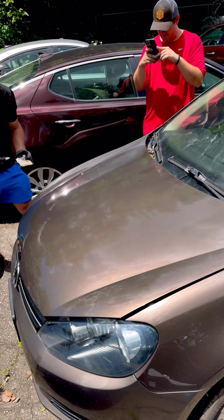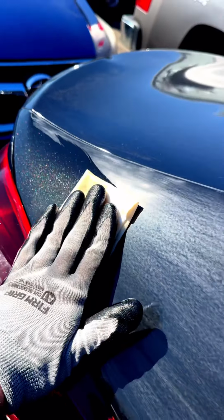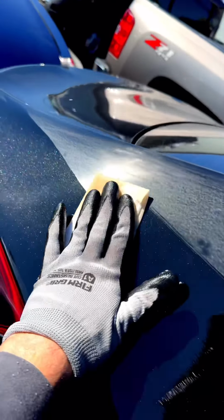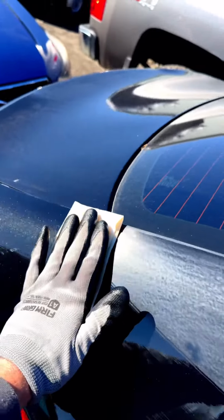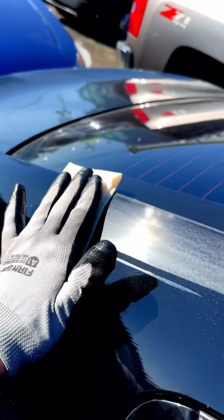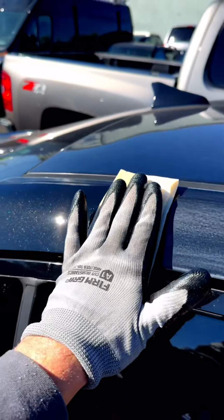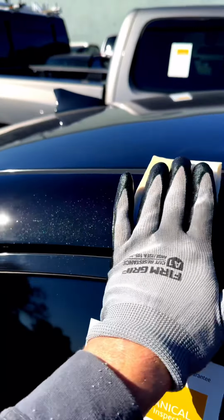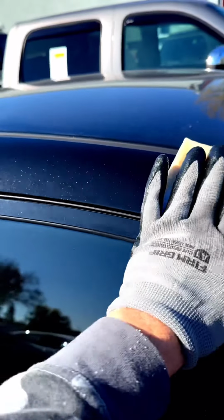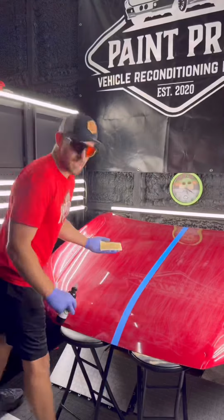So when we talk about multiple coats, we have to talk about sanding, because Shiny Car Stuff is so hydrophobic that it will not adhere to itself. So we're talking about adhesion. In between coats of Shiny Car Stuff, you do need to sand with probably 3,000, 4,000, very gently, just scuff up so that second layer can bite into it. So sanding is definitely needed for that finishing coat for really bad vehicles if you want a pristine, beautiful, body shop looking result.